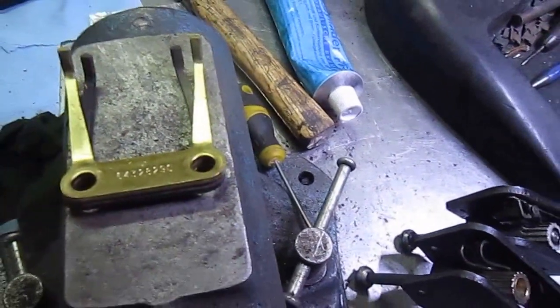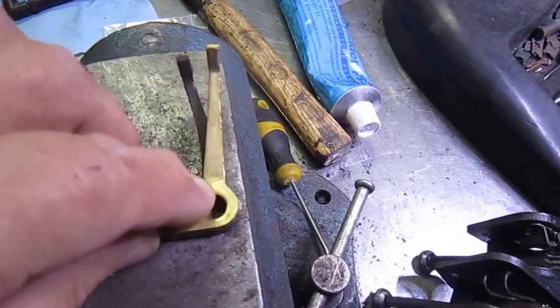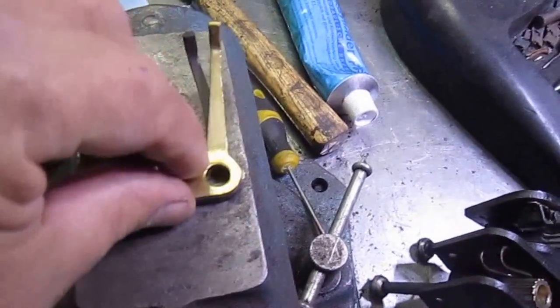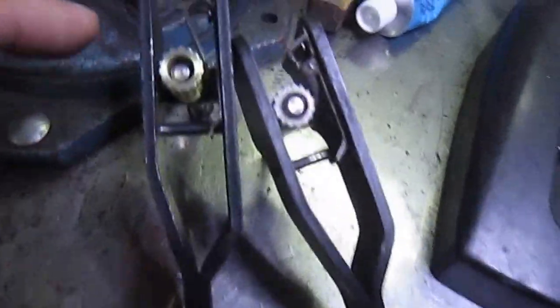On a video some years ago when I was doing the E-Type one, I think I showed where there was a stress fracture across the corner. This is the problem with them: not only do they lose their memory, but you can get little fractures across them, and as I say, they recommend when you change the pads, you change these.